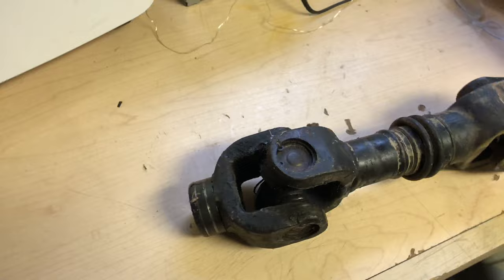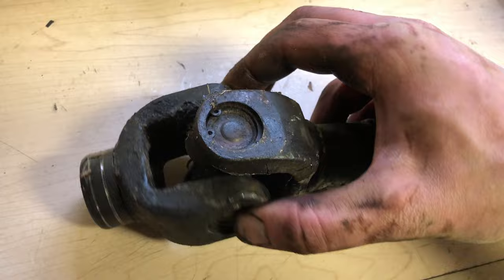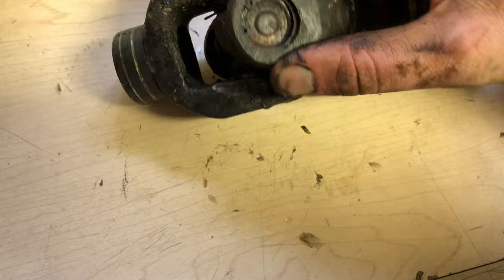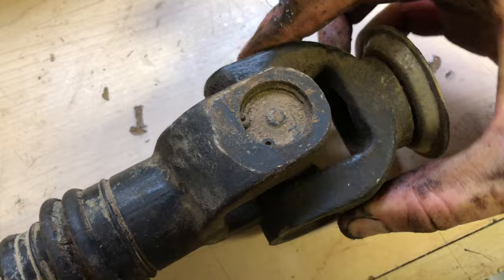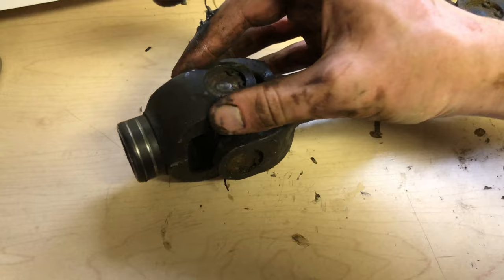After a bit of wiggling, I did get the driveshaft out. Just to give you an idea of how bad this thing is — this was at the rear. That was not going to last much longer at all. You can see in here, that cup is absolutely split apart, completely destroyed. This is why I didn't want to take that thing on a ride this weekend, because it was making noise and I knew it was on its way out. This front one has a little play, but at least it's not too bad. Good thing we're changing that.